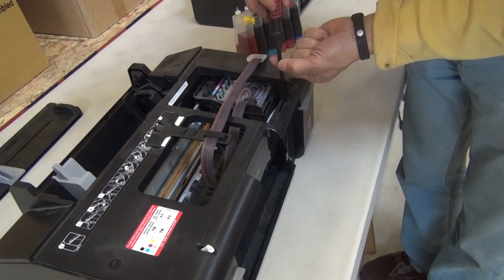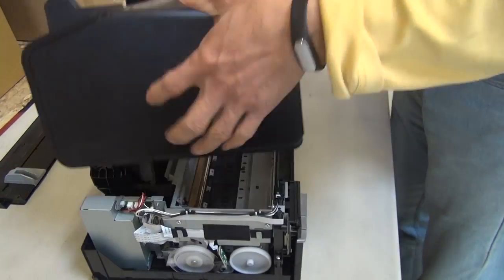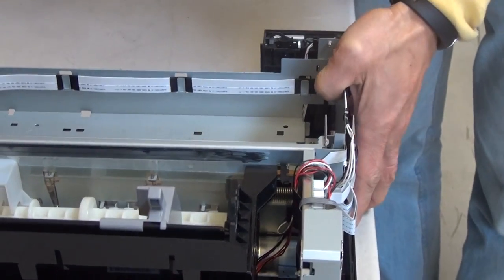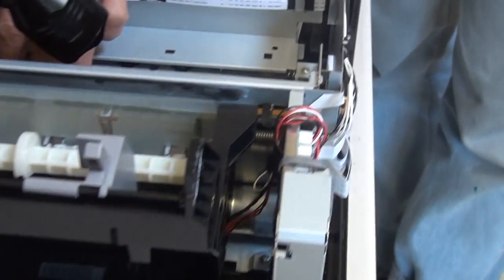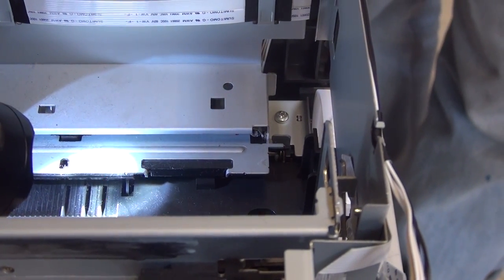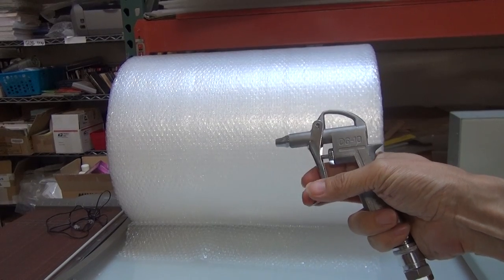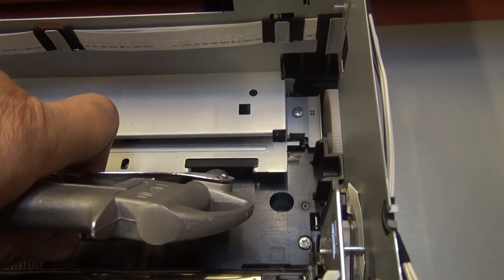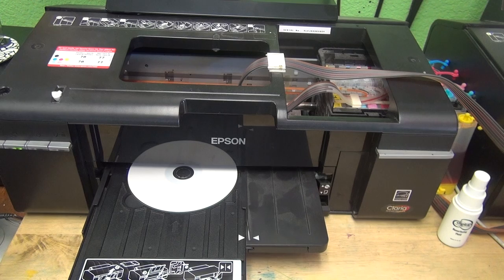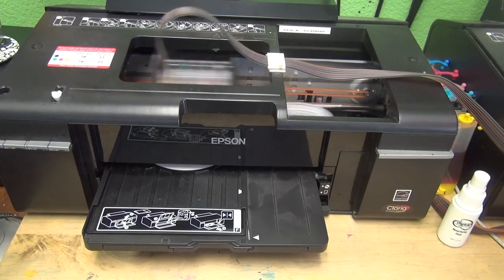Next, let me see if I can find anything in line with the white rectangular hole along its path. Voila, there it is. If my theory is right, let's blow the hell out of this sensor with some compressed air. And if my theory is right, then the printer should work now. Let's test it. Bravo — it really works!